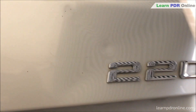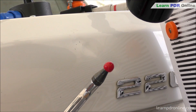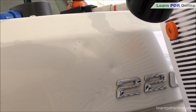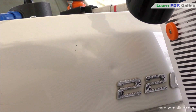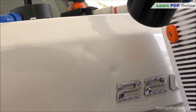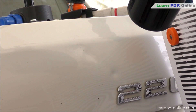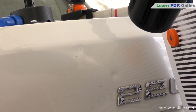Taking another look across the panel with my line board, I've massively reduced the tension in that crown above the body line. I'm sticking with my double bend bar with the R4 tip and cherry cap. I've got heat directly facing this small dent and I'm keeping that heat running continuously. Once I know my tip is directly behind the deepest part of this dent, I'm going to start the pushing process really gently, just starting to work that dent out.